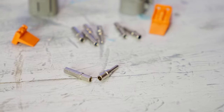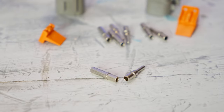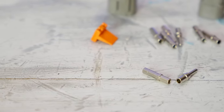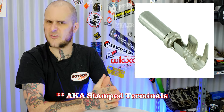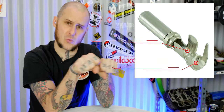There are two types of terminals that work with these things generally: open barrel and closed barrel. What I'm showing you here are the closed barrel ones. These have a really nice all-encompassing design with no fiddly parts — much stronger. They crimp on really nice and tight, uniformly around the wire. The open barrel ones are probably what you're more familiar with, similar to weather pack connectors. They have two different crimp points — the crimp that crimps down on the conductor, and the crimp that crimps down onto the insulation to hold the terminal to the wire.